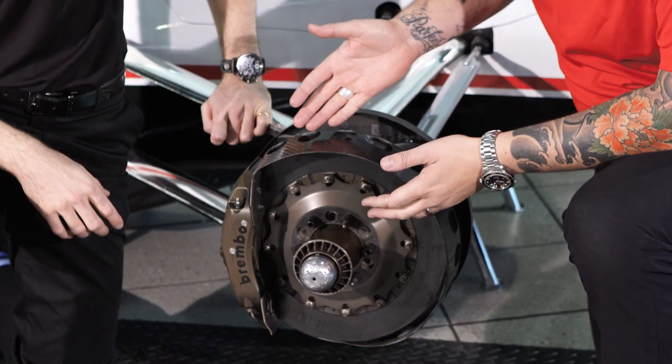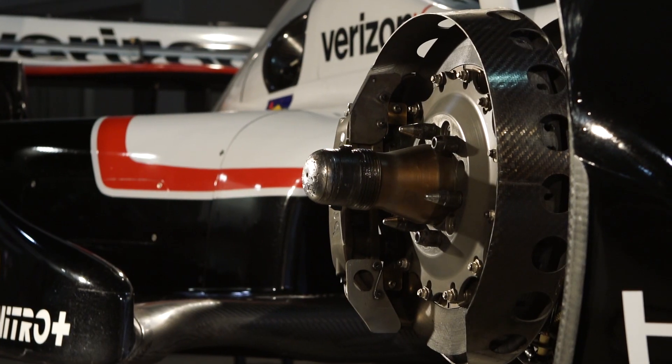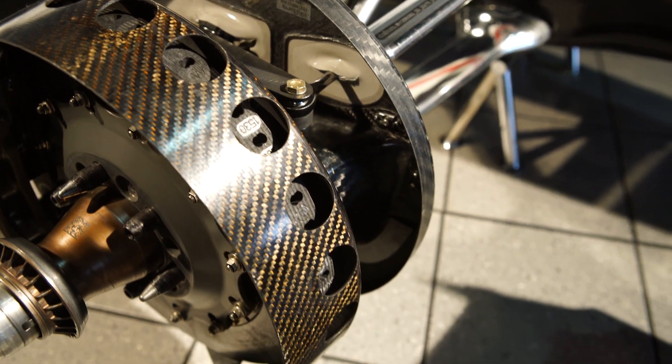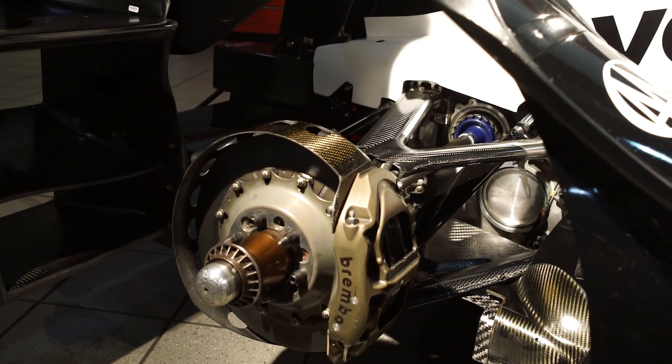Alright, so if you're going fast, this is how you're going to stop. What are we looking at here? There's some fancy materials going on. So we have carbon brakes and a six piston Brembo caliper. It's very important that you have equal temperature over the axle. We have sensors integrated in there to make sure that we have the temperature that we want, the brake pressure that we want. It's full of sensors that you can't see here, but the engineer gets to see everything that I do with the brake.